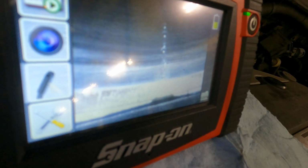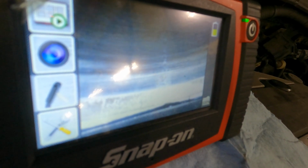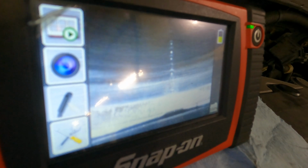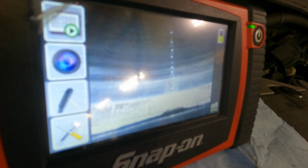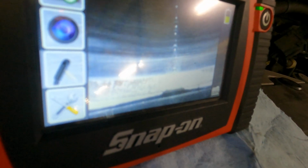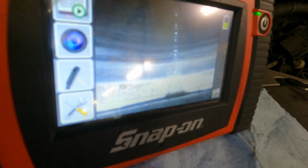And the rate is very slow, so during normal operations the in-cylinder pressure is a lot higher than that of the coolant system, so it will never overcome the in-cylinder pressure, meaning the coolant will never come inside. However, when you allow it to stabilize, the in-cylinder pressure gets back to 0, the block and the head contract, and the head gasket obviously is damaged here, or maybe the block or the head is warped, who knows, we'll find out, and maybe I'll make a next video on that.